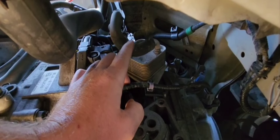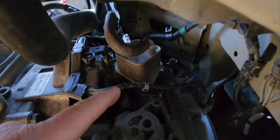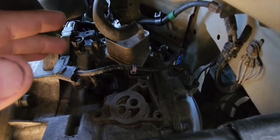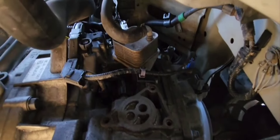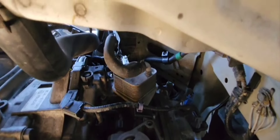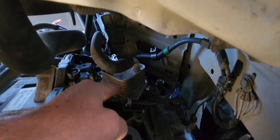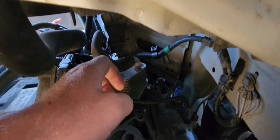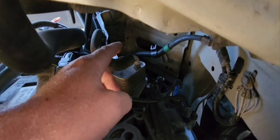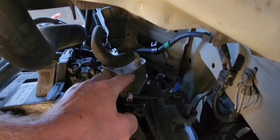You don't need to drain your coolant to get this. I'm just going to kind of move it out of the way, pop the new filter in, pop the new o-rings on, and put it back. But first things first I'm going to take that battery tray out so that I can film it from above — there are three bolts holding this thing on and two of them are on top. I'm fairly confident you could get it out from here though.